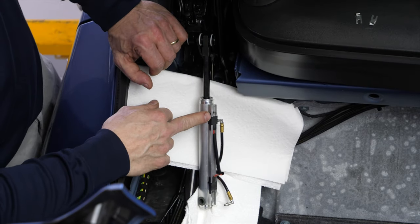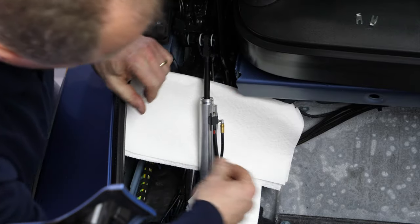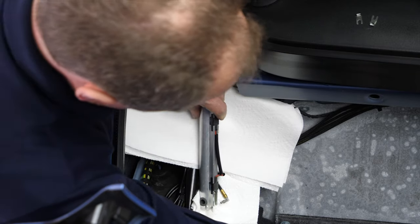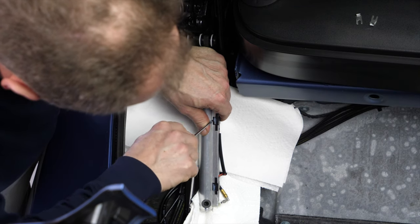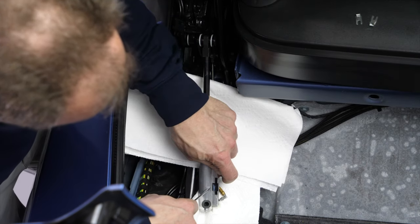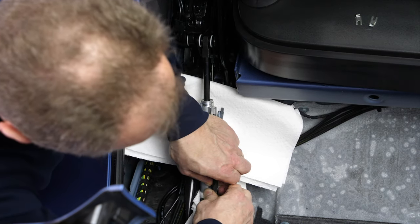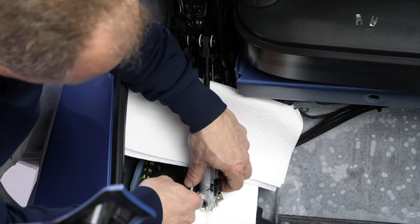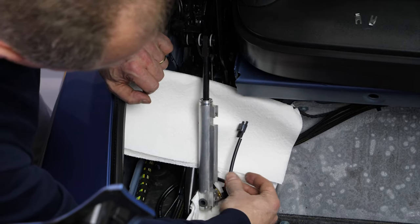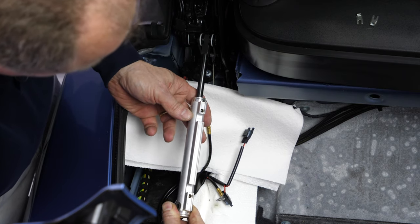Now the travel sensors are just plastic housings that are clipping into these gaps on the cylinder. So my favorite way is to first try and wiggle them loose. Well, these guys are not moving much, so I very carefully, gently wedge my screwdriver in here under the clip, push it up. Same here. We don't want to be rough on them because inside these sensors are integrated circuits with a magnet on top of them that have a Hall sensor in them, and that again does this fancy detection scheme. So we have all the hoses and travel sensors removed.